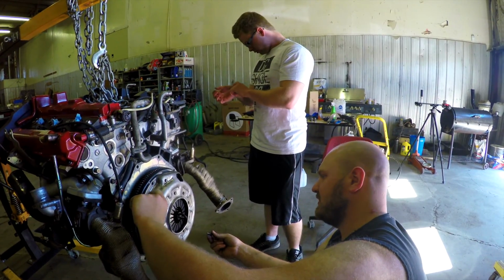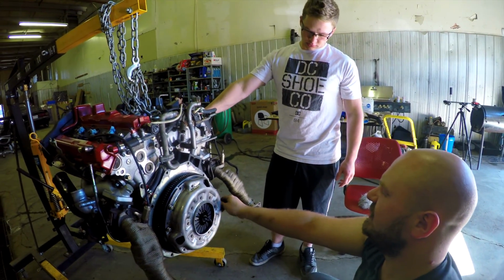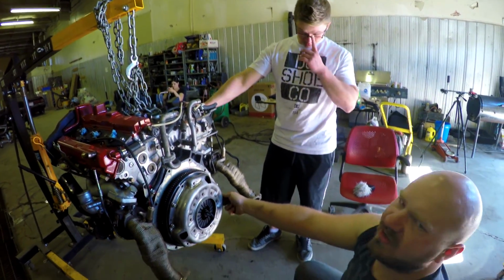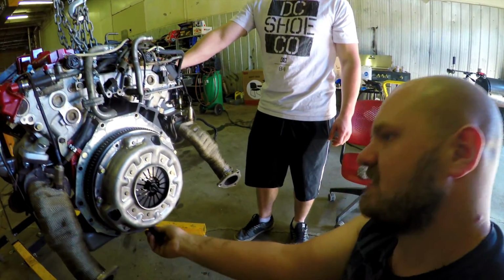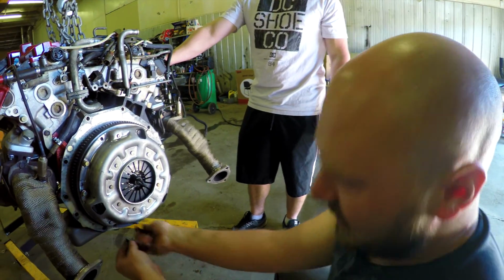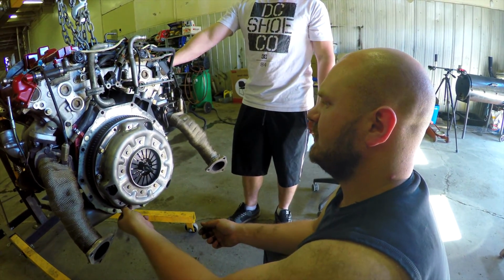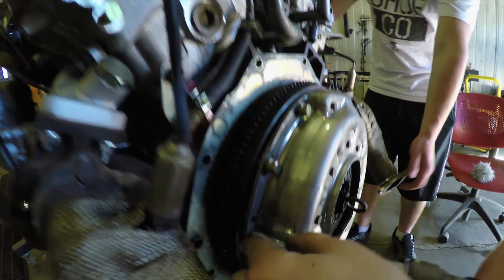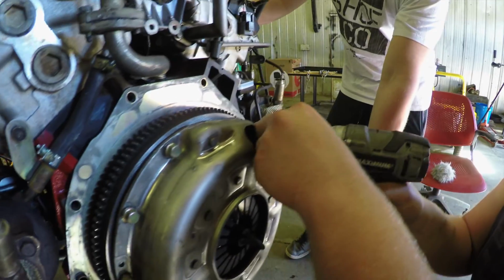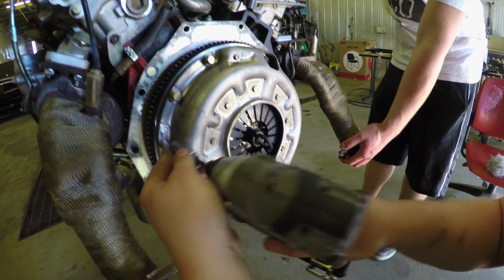So when you're tightening down a pressure plate, you kind of want to make sure that you get the pressure evenly. This is kind of an odd clutch because normally there's only 6 bolts. This one has 9. So there's an even greater chance to screw up. But normally you want to start with the dowels because the dowels are a friction point because they are a pressure fit component. Start getting those nice snugged in the same sequence that you would basically do a tire.